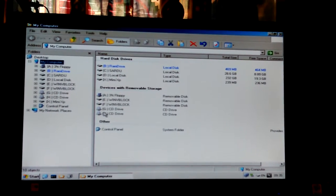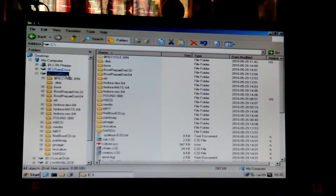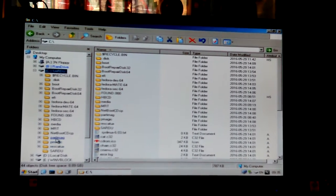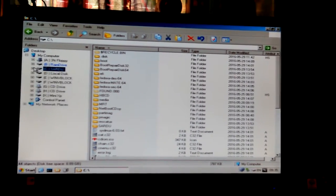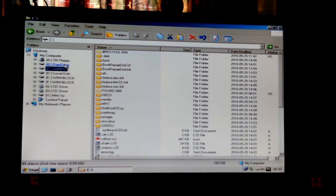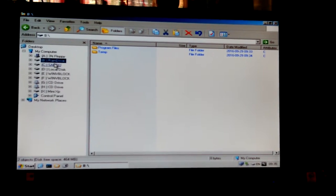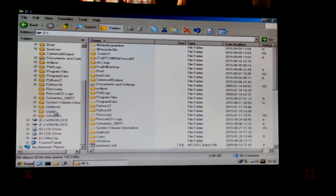It'll mount up everything. Let's see - SARDU, that would be my CD. Let's see which one - there's the live SARDU there. Magic, no, that's my USB stick. C drive on here changes depending on what you booted up to, so you have to learn that if you're going to use it for working on your system. You can't just assume C drive is C drive. That's a RAM drive - files that have to be loaded into RAM.